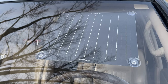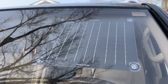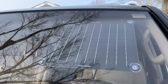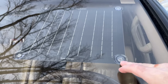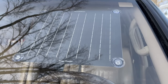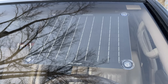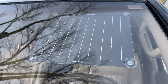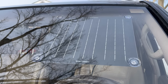That's the ECO-Worthy 10 watt solar charger maintainer. If you have a vehicle, mower, motorcycle, or RV with a 12 volt battery you don't use regularly, it's a good idea to have a battery maintainer connected to it. If you don't have power where you store your vehicle, a solar charger maintainer is a great option. I like that it's waterproof and UV resistant — you can put it inside or outside the windshield. It comes with suction cups, but with the grommets you could find other mounting solutions too. It comes with an SAE connector, alligator clips, and a 12 volt plug. SAE is the standard for these devices, so you can find other adapters. One thing to consider: check your polarity, and if needed you can get polarity reversers to make it compatible.